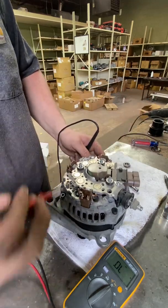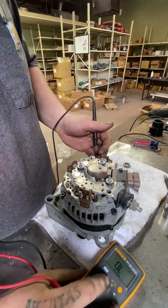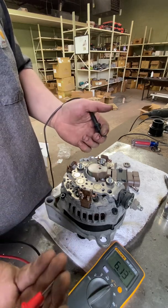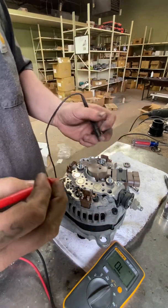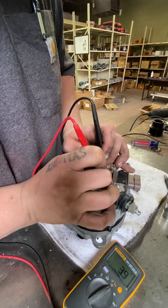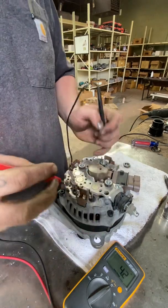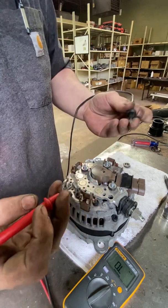Now that you've tested all of your diodes and they're okay, switch the multimeter back to an ohm setting. This one has an auto range setup. Some meters you'll have to manually select between 2 ohm, 20 ohm, and 200 ohm — generally the 20 ohm setting is all you need because you're going to read anywhere between 1.1 and around 6 to 7 ohms. As you can see, we're auto ranging and reading right around 4 ohms, so you know your brush holder and rotor are okay.